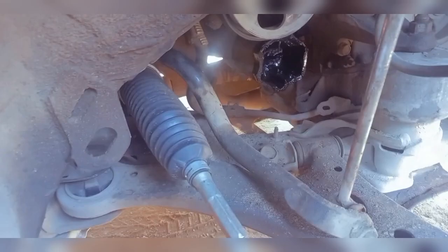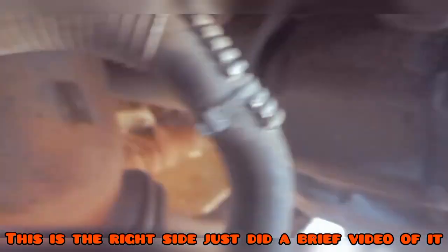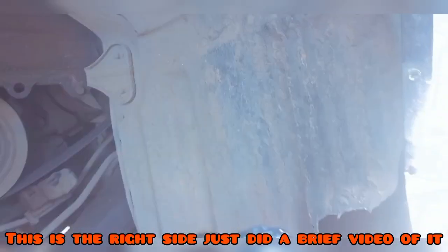On this side I didn't take out the whole length of it. You can see that's the inner cup. It has a bearing on that angle there. I don't know if it's clear. So I just took out half of it, the shaft here. This is all greasy and messy. This cup doesn't really go bad, and the bearing on this angle is very tough to take out. In the process you might hurt the bearing or the casing, and these things never go bad. In my life of repairing cars, I've only replaced this bearing once for making noise. It sounds like when the propeller on a four-wheel drive is bad. So I'll be changing it halfway like that, so we don't make our work unnecessarily long.